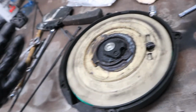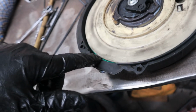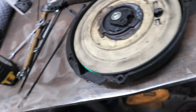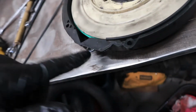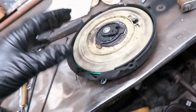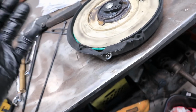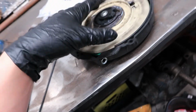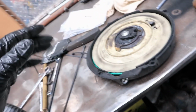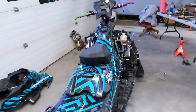Just because it didn't break that bad. But what I need to do is pull and figure out how I can get this out. Try and pop the cord up, work it around, and then pull it back through here. For this, you do not want to preload, maybe by 1, give it a little bit, but you want to have it basically at neutral here. In my case, because it unwound the way it did, just leave it, and then we'll get it fed back through, tie a knot, get it fed through the pull cord there, and then we can go.